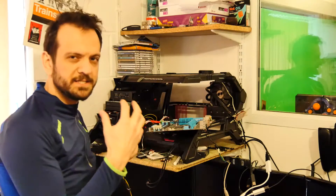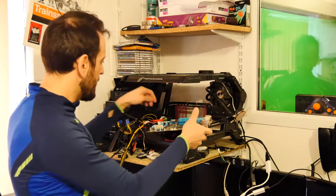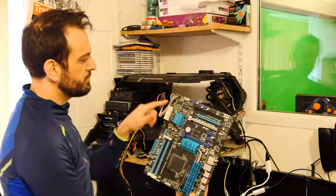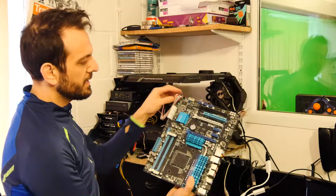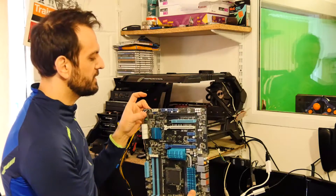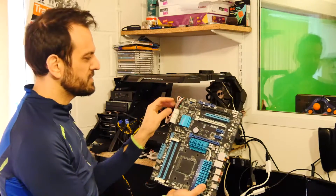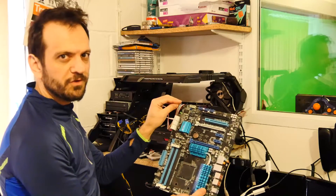I've got all the bits and bobs out. One top tip: I dangle all the wires and cables in obvious places so I know to put them all back. Before you remove any of the complicated multi-part connectors with loads of little jumper-type connections, get your second motherboard up next to it so you can swap them over directly. Sometimes there's an orientation issue - it's got the hard drive LED, power switch, reset switch - all those little fiddly ones. Side by side, just swap them over one at a time.